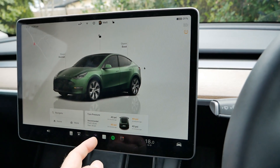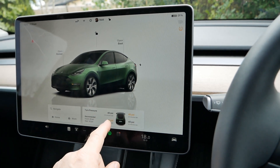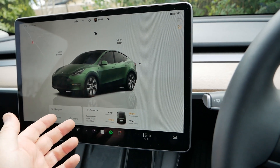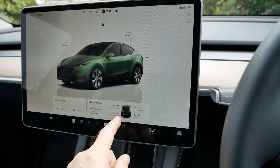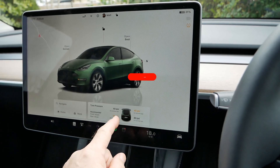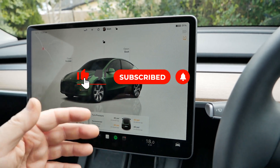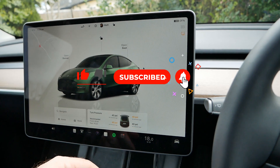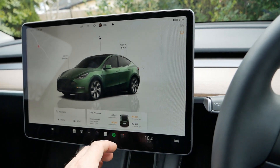As the seasons change you'll want to adjust your tyre pressures, but there's no real urgency to do it today because tomorrow might be a warmer day. As we regularly get colder mornings I'm going to want to increase this pressure so they're at 42 psi in the morning before driving. As you drive during the day and your tyres warm up, they'll naturally increase three or four psi anyway.